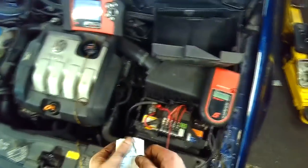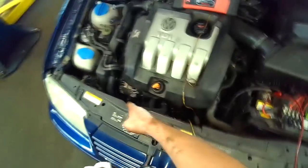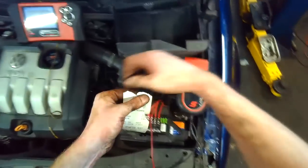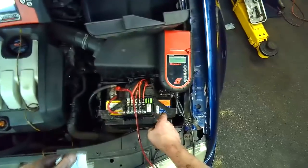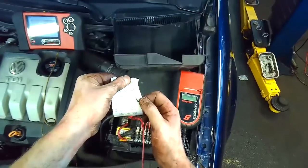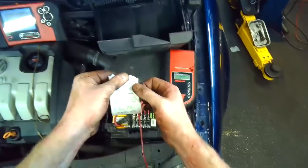Here's a good example of somebody not checking the basics. The alternator is new, or it doesn't look that old. When checking the battery, sorry, I tore the company name off by accident. So battery test, good. Recharge, it's rated at 610 cold cranking amps, or sorry, 615. It's putting out 611. So at that point, I don't even know why it says needs to be charged.